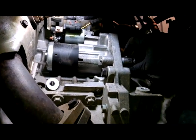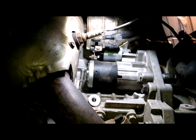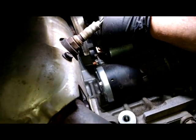15 millimeter starter bolt left because we already got the other one up top. Although you really don't have to take the air cleaner assembly out. You can probably get everything from below here. But kind of a personal choice maybe even so. We get a 13 millimeter nut here, and then the connector right here. I already loosened this nut a little bit.